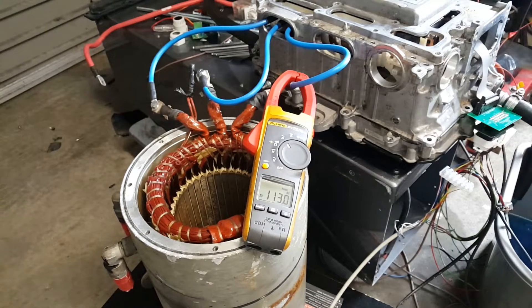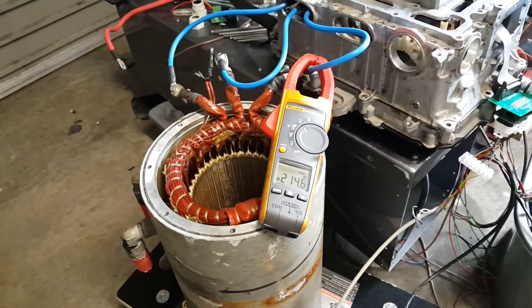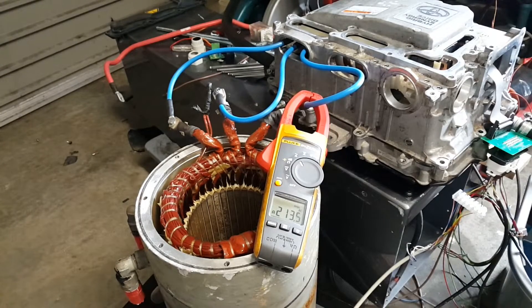There's 120 amps. 170 amps — again RMS, folks. There's 220 RMS amps going into this thing now. This is from MG2 on our Yaris inverter alone. What I'm hoping is that if something does melt, someone in the YouTube comments will tell everyone the timestamp in the video where the fun stuff happens, so you don't all have to sit through this. Let's see how long it can take 200-odd amps.